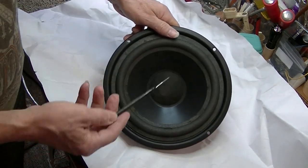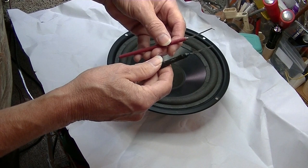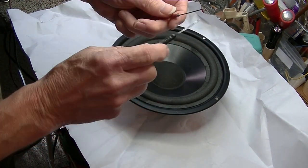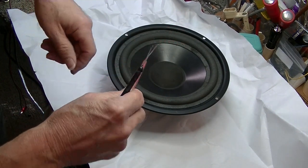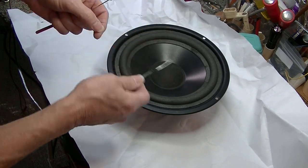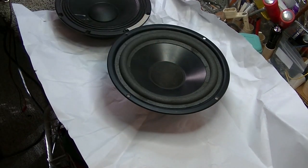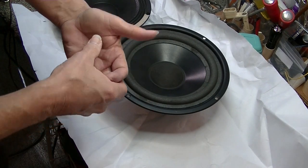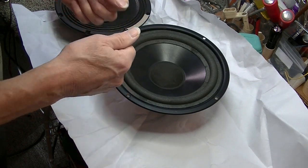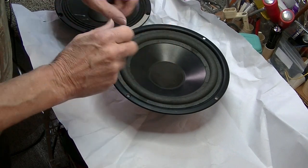Sometimes the dust cap is made of paper — it's solid. It takes something a little more substantial, and I have a couple of old dental tools. This one has a little right angle in it and it's easier to pull with. This straight one lets me do the same thing as I did with the hat pin. If the dust cap gets really crushed and mangled and still flexes when pulled up, come see me and we'll talk about replacing it. I can cut it out and put in a new one.